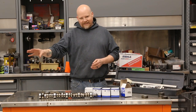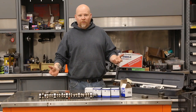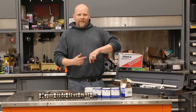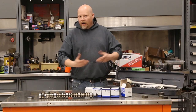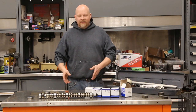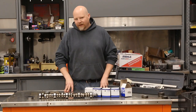We bought this engine as a takeout. We knew it had to be rebuilt but we didn't know what was wrong with it. Turned out a lifter got sideways, wiped out the cam, sent shrapnel through the whole engine. This is a common problem with LS and LT engines — they have a lot of lifter issues and cam bearing problems.